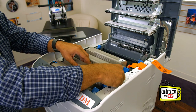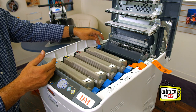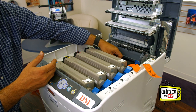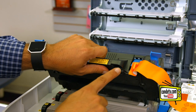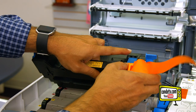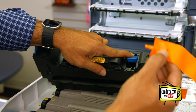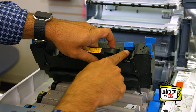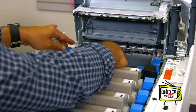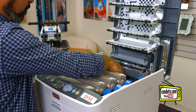You lock the toners and drums into position by moving these blue tabs forward into their lock position. The next thing we need to do is remove the safety catch from the fuser assembly. We're going to pull these blue tabs forward to unlock the fuser assembly. Now we need to remove this orange locking safety tab. We're going to do this by pressing down on this blue tab here so that we can move the safety tab forward, pulling it out. This blue tab should spring up. Now we can take the fuser assembly, drop it back into the printer, and go ahead and move our locking mechanisms back into the lock position.